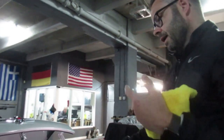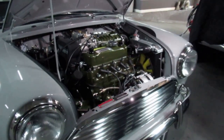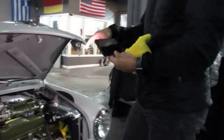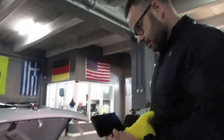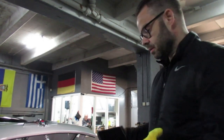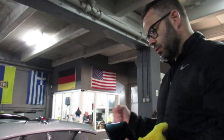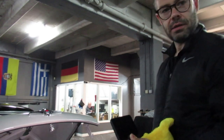From my perspective it's not high-end power — it's not like the other red mini over there which is all cammed up and has no power below four and a half thousand revs. This is just instant. It sounds amazing with the straight-cut gears whining away as well. They've got the helical drop gears in it too — it winds on the way down as well. The gearbox itself is standard and seems to handle the power alright, though it'll probably need a rebuild — it can get a bit sticky and crunchy on the way down. We'll probably do that end of the year.